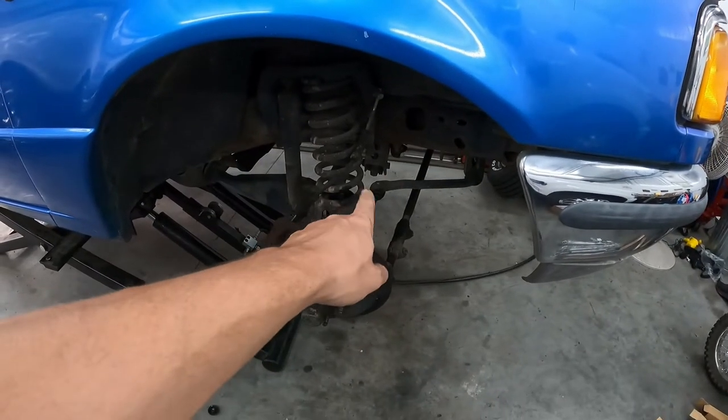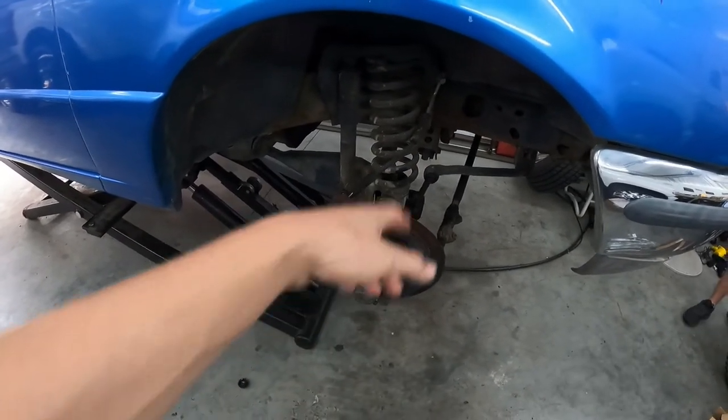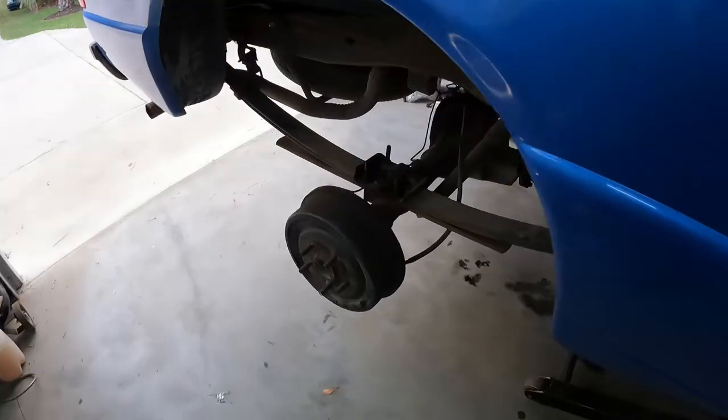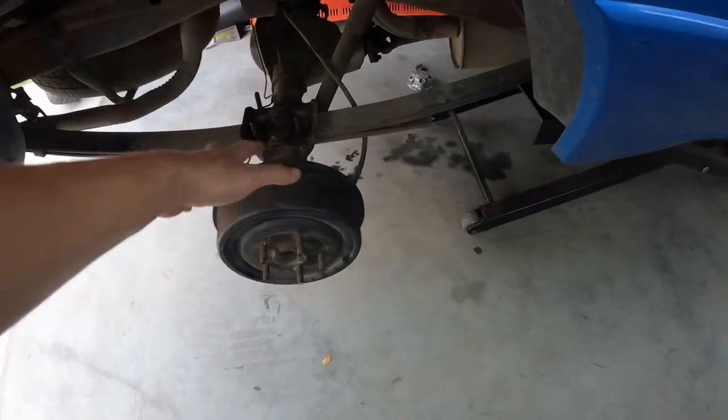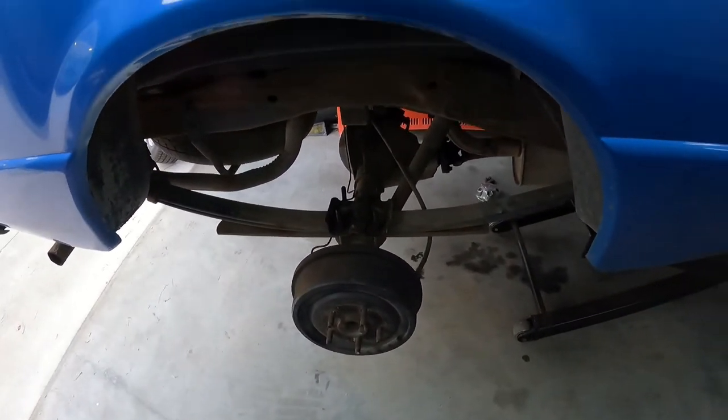It's got the I-beams in the front, so we're just going to drop the sway bar, drop the shock. He's already started doing some stuff. Drop this down, we'll have to pull the caliper out, pull the spring out, throw the new one in there. In the back, undo everything — U-bolts, take the plate out, probably just pull our leaf out, flip it, put everything back together. Yeah, we're just doing springs on the front. We're probably going to get a lot of negative camber so we can go back and just put some offset bushings in there later. But anyway, we're going to start buzzing some nuts and get this unit tore down.